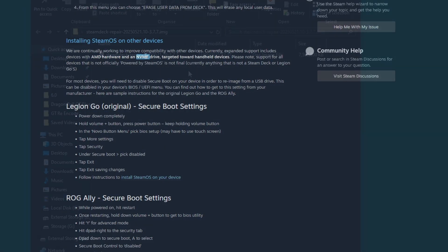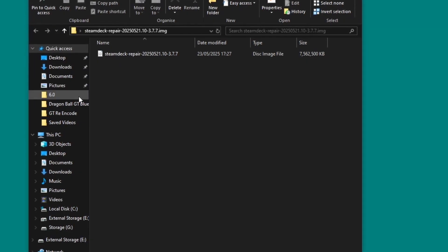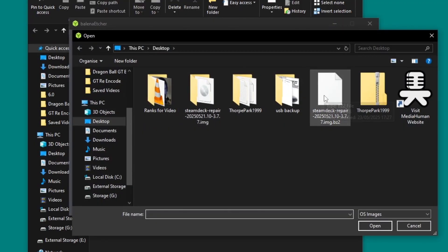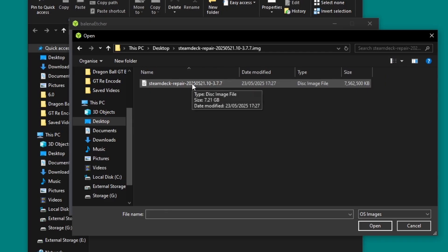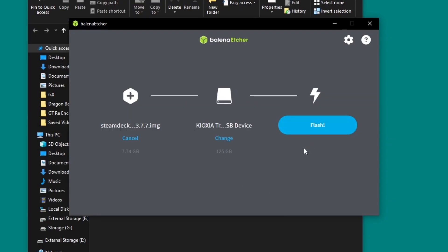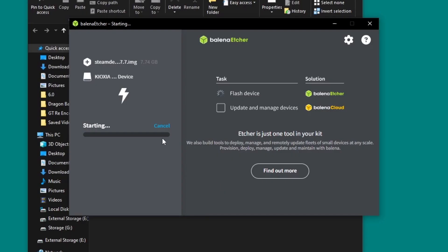After downloading, grab a tool like Rufus or Balena Etcher. I personally use Balena Etcher because it's the easiest. Click on the file you just downloaded, click on the USB device you want to flash to — and remember, you need a USB or external installation media that is at least 8 gigabytes in size, though you might actually need 10. Hit the flash button and go make a coffee, because it'll take maybe 5–10 minutes, and when you come back you'll have the installation media ready.